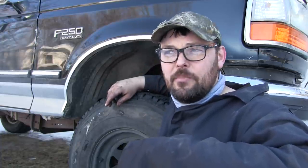And there you go — that's how you change a universal joint in a four-wheel drive front end. The seals cost about $15, the universal joint about $20, I have $5 into grease and another $5 into miscellaneous stuff like paper towel, so I'm south of $50 on a job that would probably cost you four or five hundred bucks at a shop. A job like this is not that difficult — it just takes a little bit of time and patience. Read up online, read your Chilton's manual, make sure you've got your head wrapped around the job before you start it, and save yourself a whole bundle of money. My name's Dave Whipple — thanks for watching Cheap Wheels, keep your junk on the road.